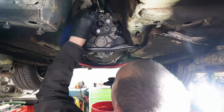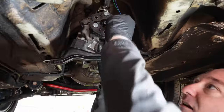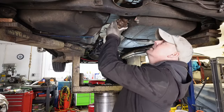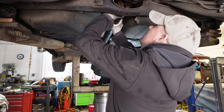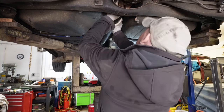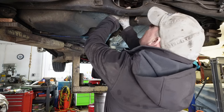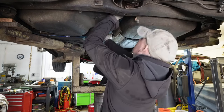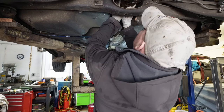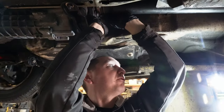You just want to make sure that those three are lined up with an arrow that faces that flange. Yeah. Hold the center up because it's got to be lined up. Okay, and then there you go. Now you can let the center droop. Okay, drive shaft is seated.